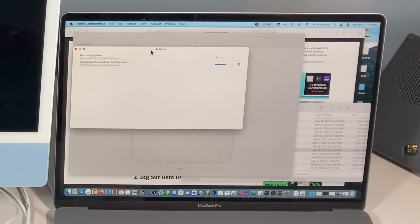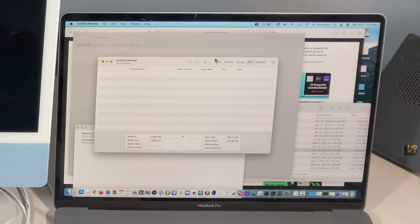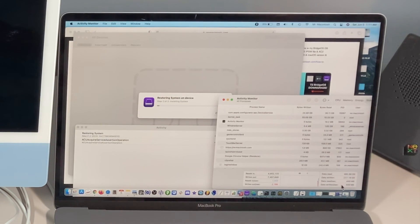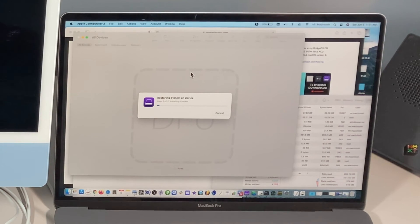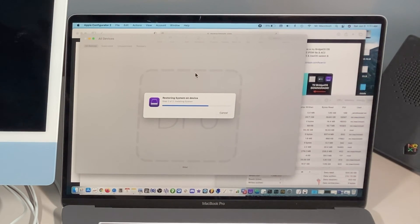If you want to keep track of progress, click View, Window, then Show Activity to see what's going on. You can also open Activity Monitor, click the Disk tab, and see the transfer speed. We're transferring data at over 450 megabytes per second — very quick. All in all, this process takes only about eight to ten minutes to copy the information over, unpack, and install macOS on the iMac. It's literally the fastest way. Look, we're already seeing it wake up — that's how fast this is going.